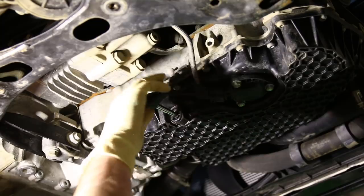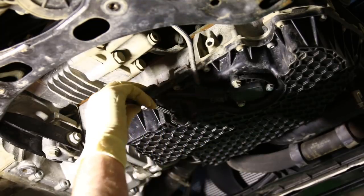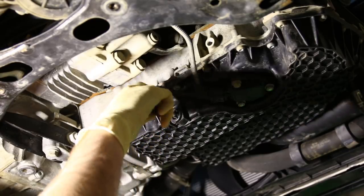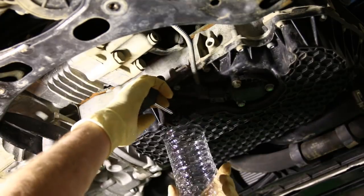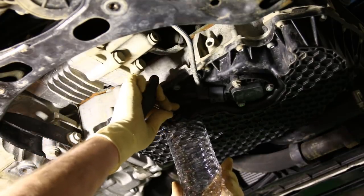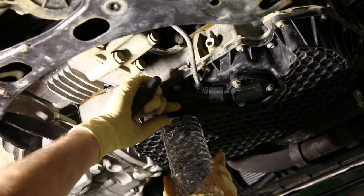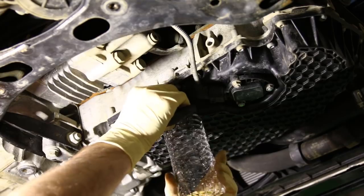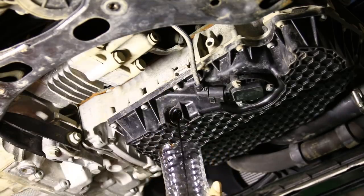Mark 7 — or really all MQB — has a specific drain plug. You can use a screwdriver but it will kind of mar it up. This is a twist, half-turn style plug, so this is the special tool — we'll link to it in the description. Remember, here's what we're doing: I don't expect to have much oil come out of here. This is just the residual of what we didn't get with our extractor. So let's take a look and see what we got.